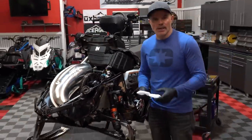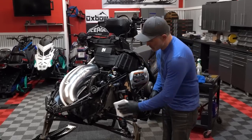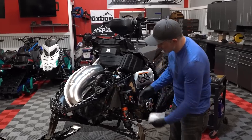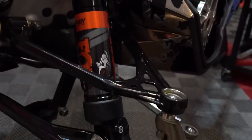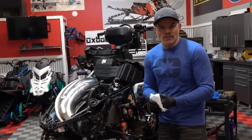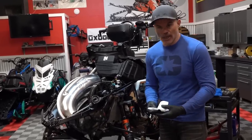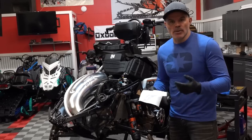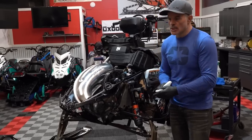While still up front of the sled, still mostly doing visual inspection and cleaning — going through the front suspension, looking for residual oil, any cracks, anything wrong with the QS3. Beyond your factory walkers, I've had to send shocks over to a friend for gas shock repair because of shocks leaking oil. Obviously when that happens, their performance goes way down. It's not that difficult or expensive to have those fixes done, but you wouldn't know it if you weren't paying attention. Suspension is easily one of the most overlooked and most essential components to a snowmobile performing the way you want.